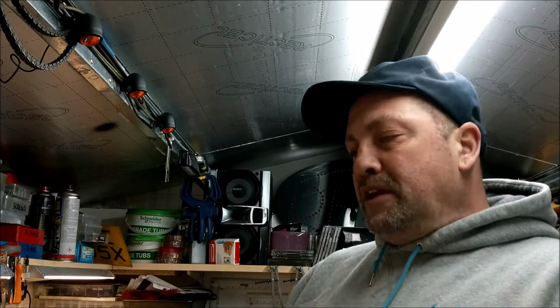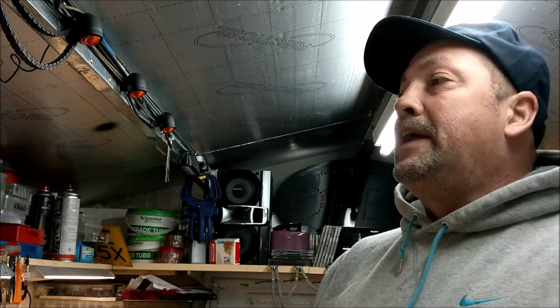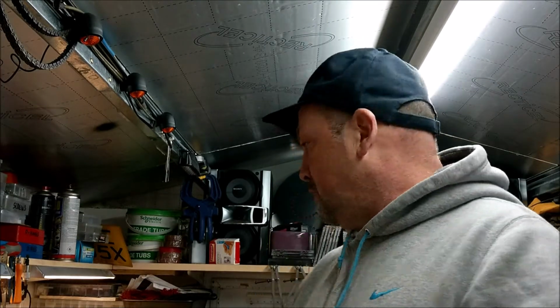Yeah, I'm going to lacquer it, and I will stick them in the oven just to bake that on. Before I lacquer it, I'm going to heat them up in the oven first a little bit, to about 75 degrees. Then I will lacquer, then I will put it in the oven. So it's paint and lacquer sticks to metal better if it's above freezing, and it's pretty much freezing in the shed right now. Mind you, I have had my heat gun on, and that's been a good heater, so I'm not going to catch a cold or anything, so that's good.